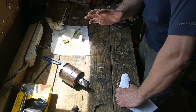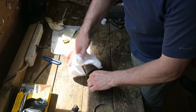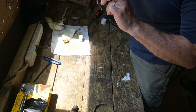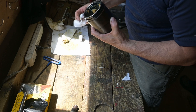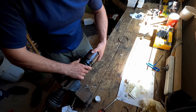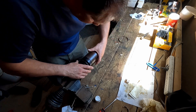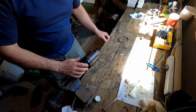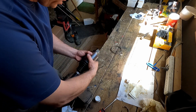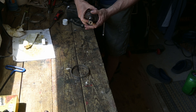One important step when putting these clamps on: make sure everything is clean — where the boot goes, the inside of the boot is clean, and the clamp and the rubber outside is clean so it doesn't slip. Push it in, line up the boot, and squish it. The boot needs to be where it needs to be. Remember it's got that chamfered edge — you can feel when you have contact.